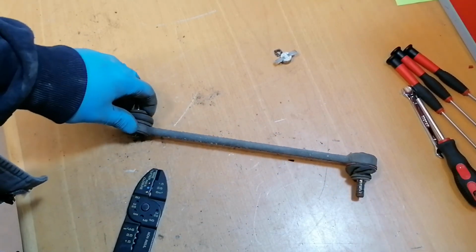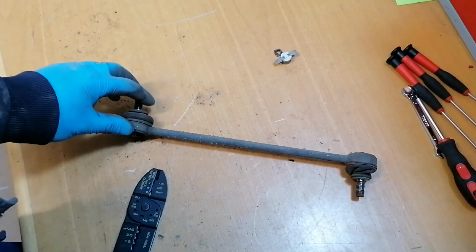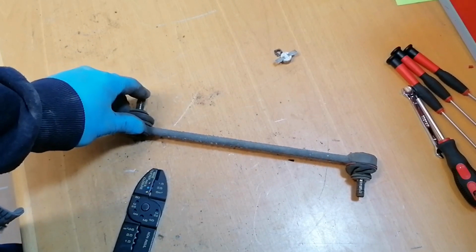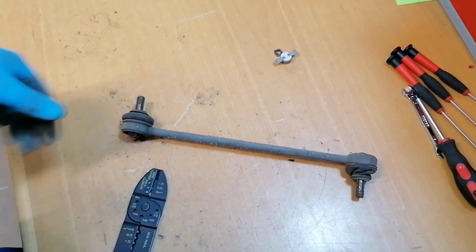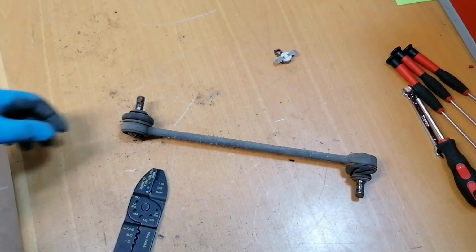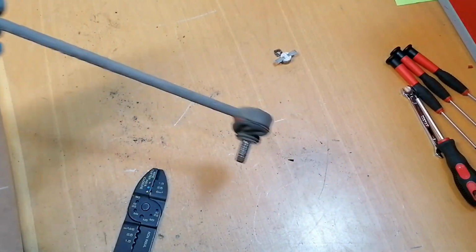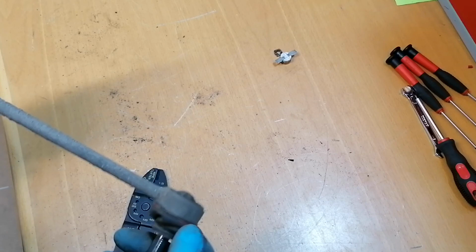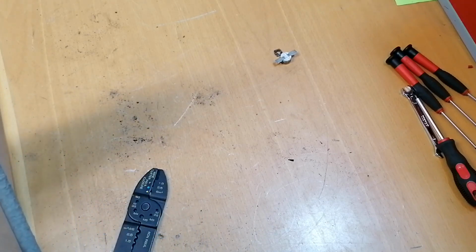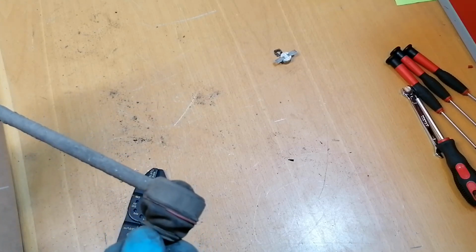When you put the wheels back, the specification for this one is 120 newton meters per bolt, so this is the tightening torque, and I always tighten the screws with a wrench that can measure this torque. So if you have a flat somewhere on the road, you can loosen the bolts easily and not have a really hard time with it.